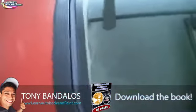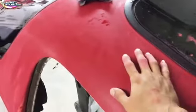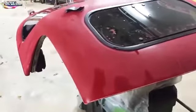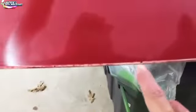We're going to clean it really well, then prep it and water-sand the whole area with 400 grit. I noticed when sanding you can see all the red on the floor — this is an enamel paint job. When you see the paint come off like that it's single-stage enamel. If you were getting a white milky residue, that would be clear coat. Miatas came out in the 90s so this paint is probably pretty old.